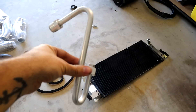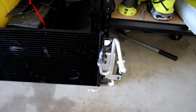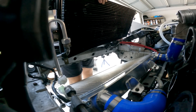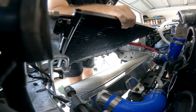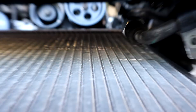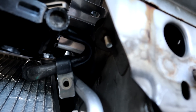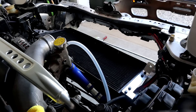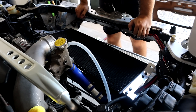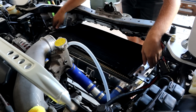Once the condenser is looking like this, grab your new AC tube which comes with it - we're attaching that at the very back. It should orientate something along these lines, but you can slightly bend it whilst it's in the car. Time to put it in the car. Quick tip whilst putting this in: make sure you don't hit your radiator. There is a small clip right there which you need to take off first. Make sure there's nothing on the actual frame rails because it is a very tight fit, especially if it's bent, which most of them probably are.